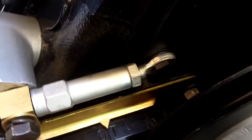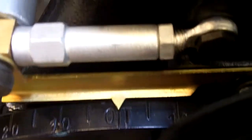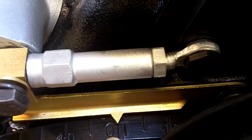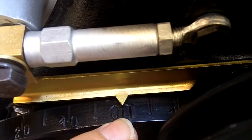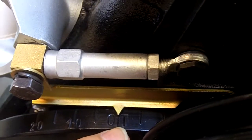Hello Lorenzo and everybody else interested in learning about camshaft timing. We're going to use this magnificent 300SL engine as an example of how things are supposed to be. Everything starts from the crankshaft — you can see the crankshaft top dead center with the timing pointer, and it's at OT. Some engines have 0,0. We're going to see how the camshaft timing marks line up.